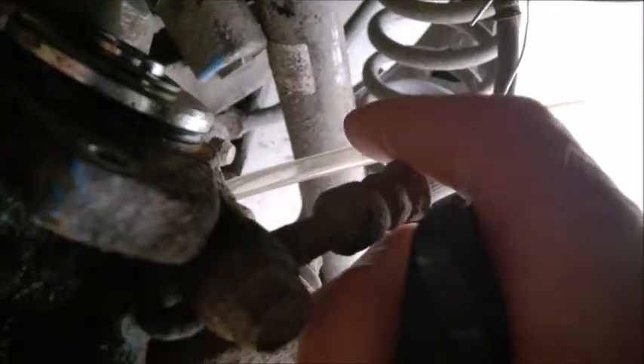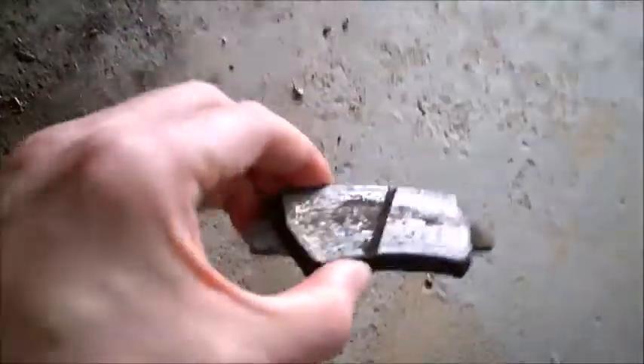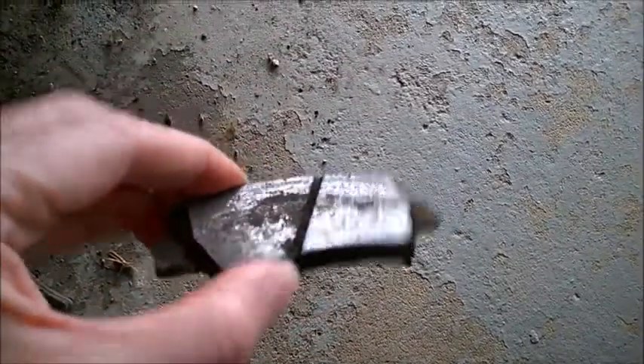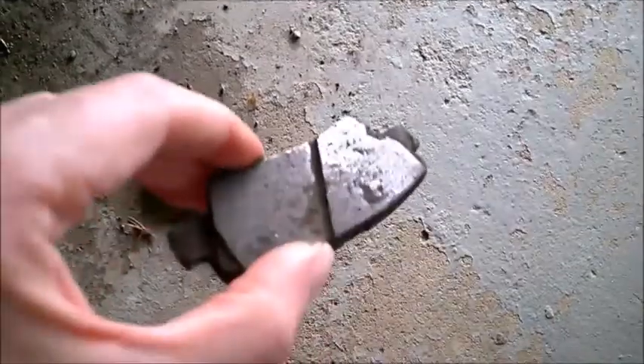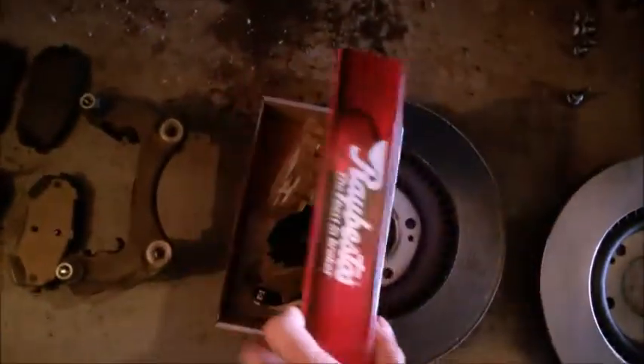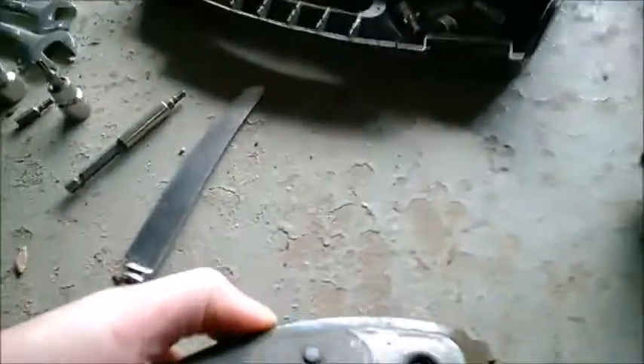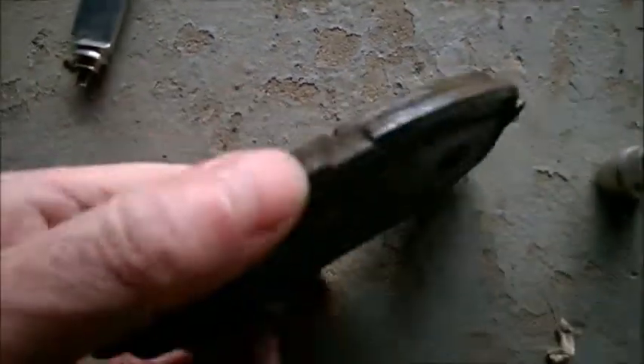At the back I'm not replacing the rotor, only the pads. The pads are really not looking very well. It's Mobis — this is the genuine OEM one. The front is also pretty worn. You need to push back the piston — perhaps the more mechanical way, since I'm not sure you can put the car in maintenance mode. I did undo the motor — it looks like small solid tips — use an extension because of the way these are placed near the rotor.